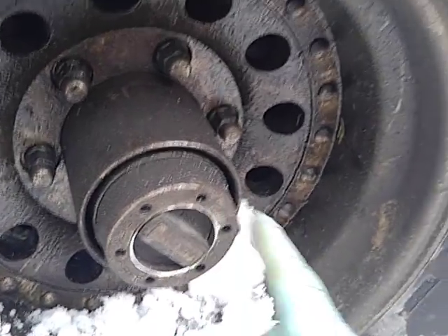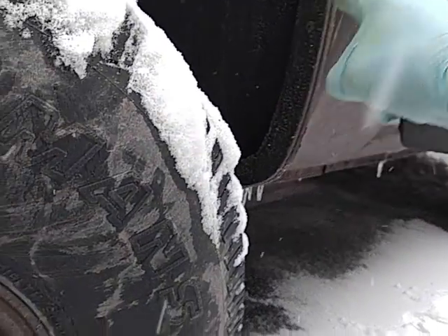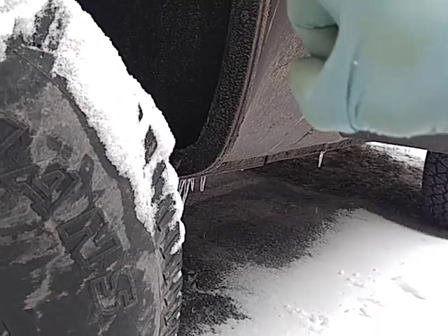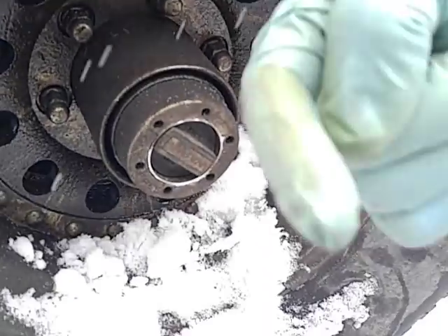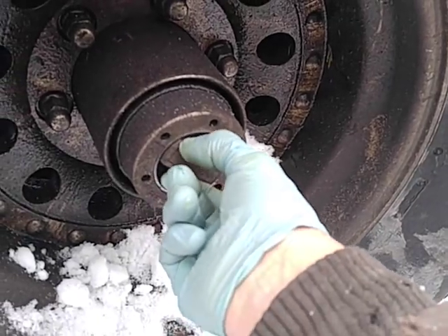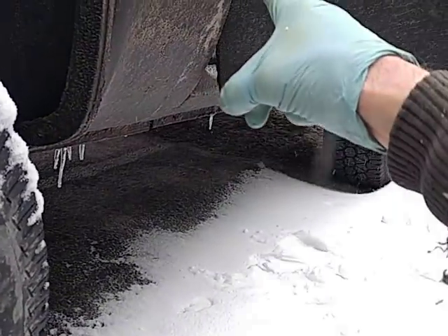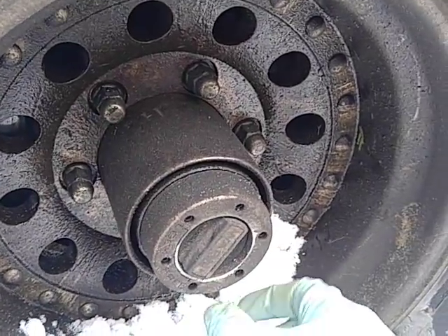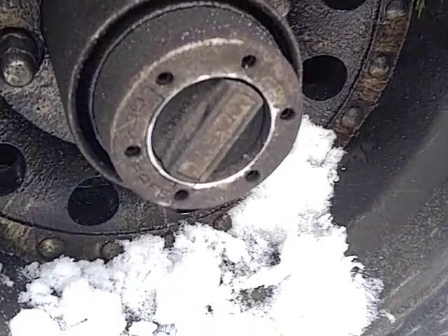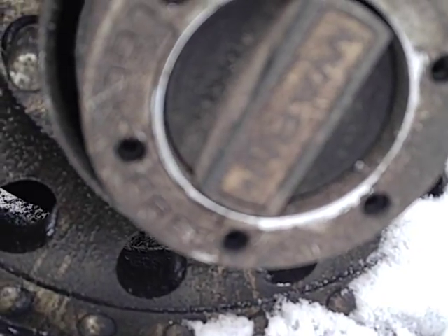Then you've got four-wheel drive as long as you've got the transfer case engaged inside the truck, which sends power from the transmission through the front driveshaft to the front differential and then to both axles. So you've got to run around to the truck, engage your lever inside into four-high or four-low, and lock your hubs. When you want to unlock them, you go counter-clockwise until it says 'free' — which you can't read because I've got fluid film everywhere — and you back up a few feet to disengage the parts inside the transfer case.